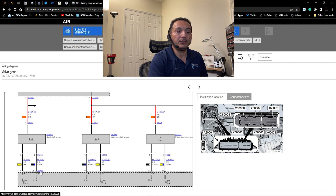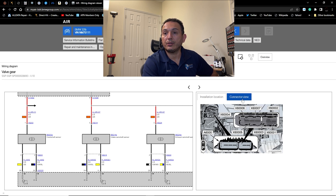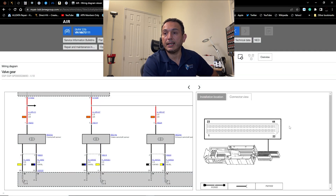For the signal, we need pin 29 on connector X60005. This connector is a 44-pin connector. To find the exact pin location, follow wire colors. In this case it's a yellow wire at pin 29, next to a black-with-blue wire at pin 30 (ground). Look for that yellow wire next to the black-with-blue to confirm your location.